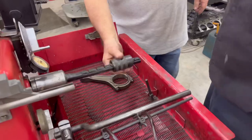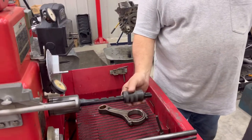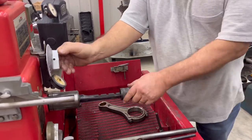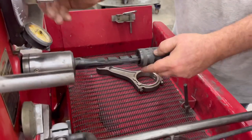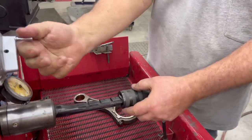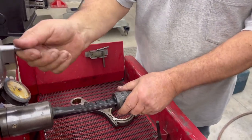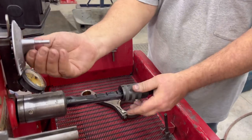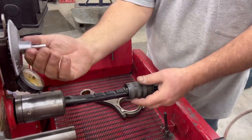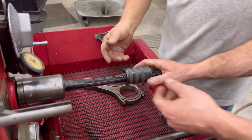Okay. These are new stones, new shoes, right? But what we're going to do, without the machine on, we're going to put the pedal down, and we're going to bring this up. We're feeding that stone out right now. We're going to bring it up till we get contact. And I forgot your shims, but... Okay, I got contact. So I just want to touch. Just now touching. Feel it?